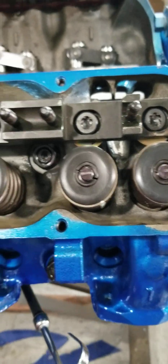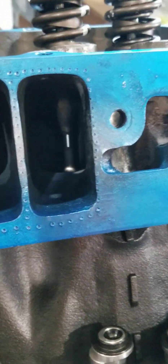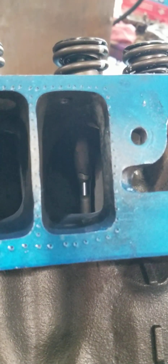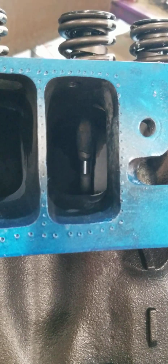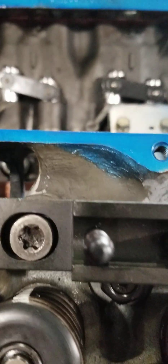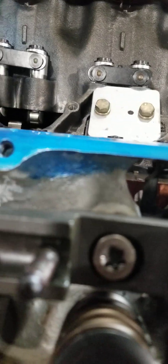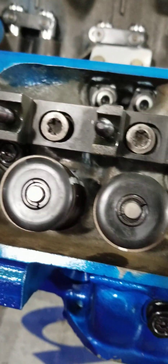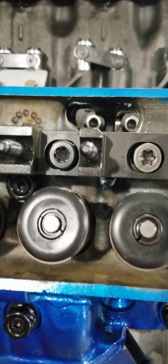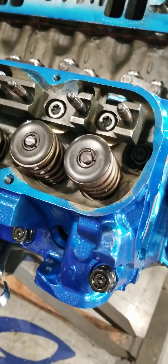What that does is it makes the engine sing - it makes it a lot happier at higher RPM. And this is going to see a lot of RPM because of these wide port heads. Some of you have been following me on YouTube with these things - they are a highly modified set of cast iron factory heads. I put a lot of epoxy in these and we moved the pushrods over, got rid of the factory pushrod holes and epoxied that all up. So we're going to have a wide port Ram Air 4 engine that hopefully will make enough horsepower to run at least a 9.70, 9.80 in a 3,600 pound car. That's the goal. Thanks for watching guys.